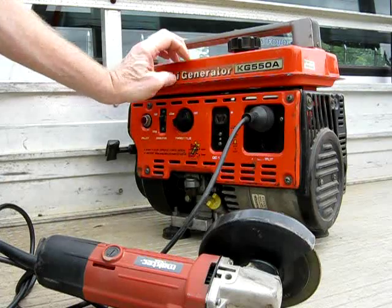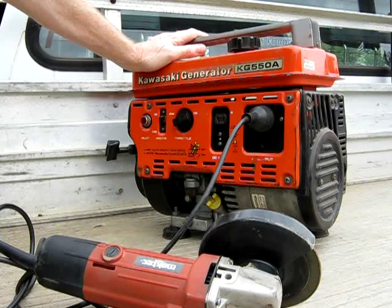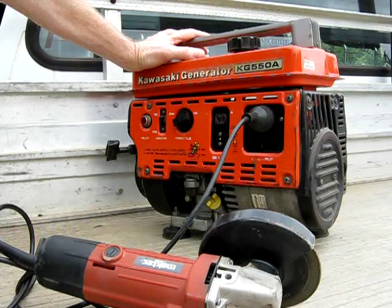So you can see it's not running too bad — a little bit of smoke. The rings will take quite a while to bed in on this, because trying to bed in on a worn and polished bore is not a great idea. There's nothing else you can do in this particular case, but as you can see, the rings work quite okay.